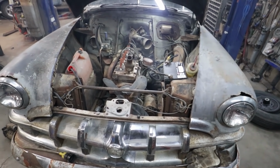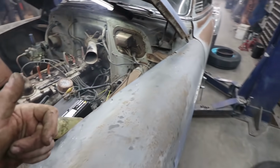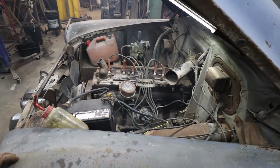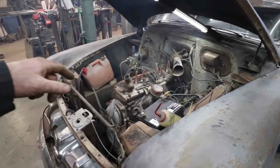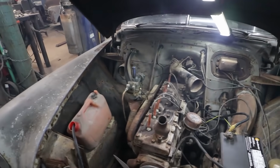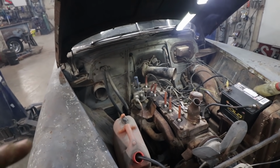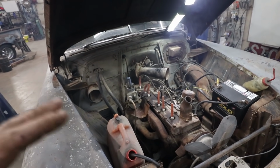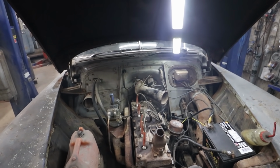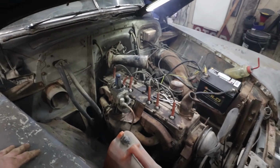Well, I guess we'll dig into that. She's a runner. She starts good. I like it. I'll have to look into, oh yeah, did you hear that? That's definitely that stuck lifter. There's two of them, sounds like. Heard the two thunks. I think we get her warm, she'll soften up. She'll get there. It's got good oil pressure because it's at 45 pounds or whatever when I look quick. Yeah, well, that's pretty awesome.